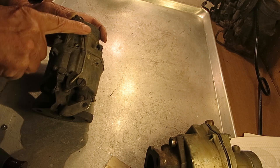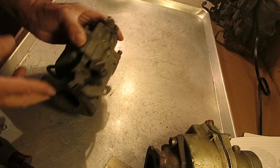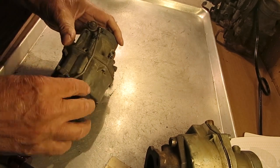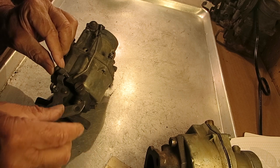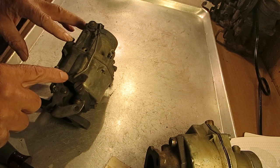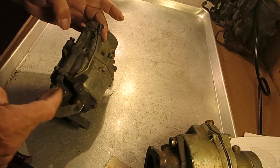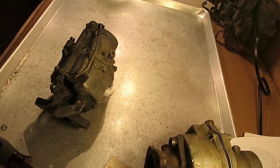On all of these, you're going to have a loose rod — they're just worn from many years of age. I already mentioned the throttle valve: if it's in backwards or something, that's how the fast idle works. With the choke closed, it's going to get on the fast idle. Sometimes to get on the fast idle, you've got to open up the throttle just a little bit because see how it catches? I'll also take a picture of this and put it in our technical section, as we do get questions about how it's put on there. I hope that helps you on your fast idle. Thank you for watching.